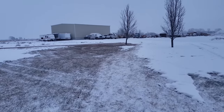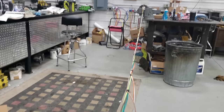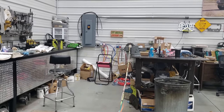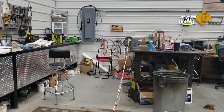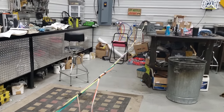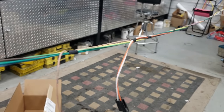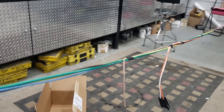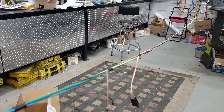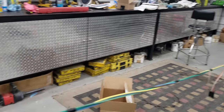Oh, lovely day. Okay, so here's my rear harness. I've just kind of wedged the end in the vise. I didn't clamp it down; I didn't want to break it. And I've just kind of taped it every foot. And then there's my dome lamp extension and my gas gauge wire. They have to come out of that loom somewhere in there, so I've taped it back to here.